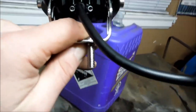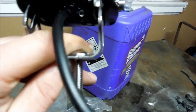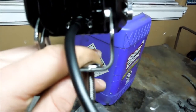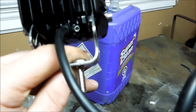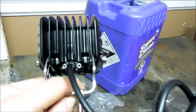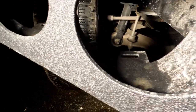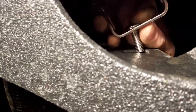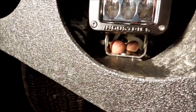There's a square on the top of this bolt, and the reason why is you're going to put that through like this — the square locks in there, and then you just cinch down your bolt. It'll go flat washer, spring washer, then nut, and you tighten it down on the plate. That's how we got it in the bumper. There's a hole in the bumper that we put this into, and once you have it in the hole in the bracket, again — once it's through the bumper — washer, spring washer, then nut. Just tighten it down. So you're going to bring your light in from the rear, and now it's in the hole. Put your washers on the bottom and bolt it in.